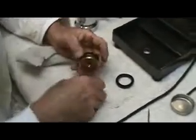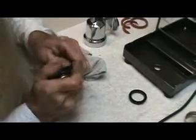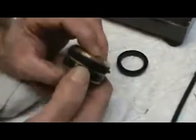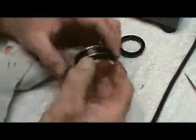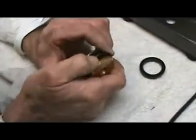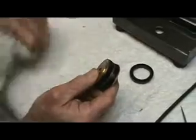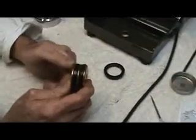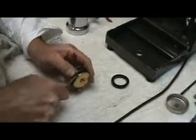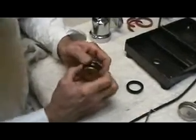I wish I had gotten some hot water because these seals are pretty stiff. Now you see how it's kind of cupped weird? That's part of why I put the lubricant on — because I want it to be able to slide. I either use my fingers — see that? I'm just pushing that into place, just pushing it into the race, into the groove. See how that looks now? You can take a tool, take the back corner of it, and push it down to make sure that leading edge is all the way seated. Basically it's in the race.